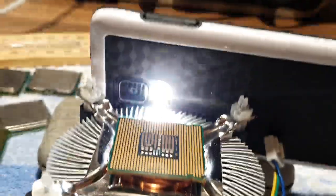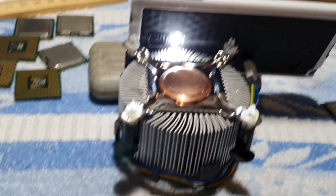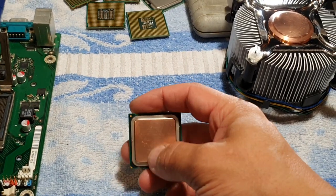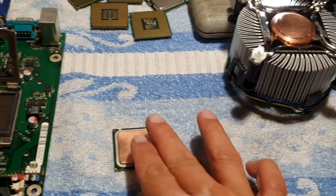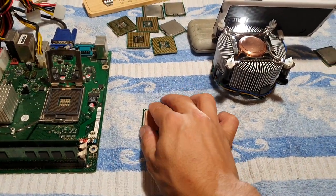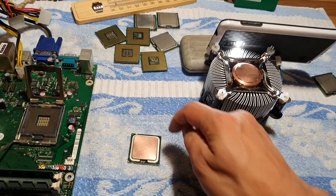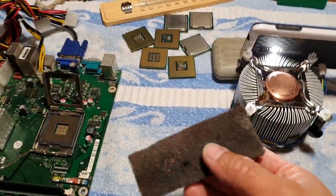Okay yeah guys I think this has shown you a lot of proof right now. You can see when it's just polished yeah — when it's just polished too much like a mirror, you just get it one time back and then you have some small scratches. That's why I have now just lapped it with 1000 grit and I have not polished it anymore because it's just too much when you polish it too much and it looks like a mirror, but if you take your fingernail and you just touch it one time you're gonna see a scratch.